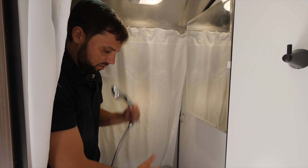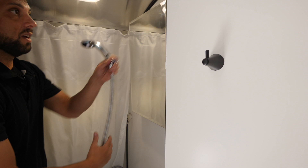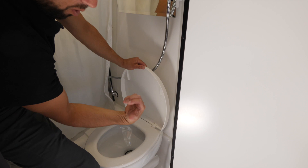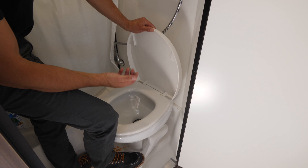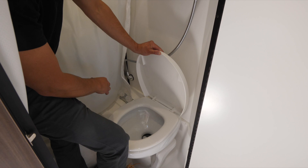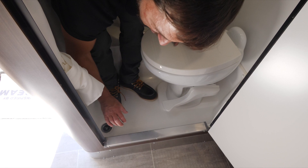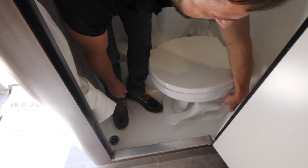There's a medicine cabinet with removable shelves and a mirror. The toilet has a porcelain bowl with a ball valve — partially push the paddle to fill the bowl with water, push all the way down to flush waste, then lift up to seal the ball valve. On the floor there's a drain plug — best practice is to keep it in when towing to prevent tank odor from escaping the P-trap. The bottom pan is fiberglass, the top is water-resistant laminate, and a few seams will need caulking maintenance over the years.